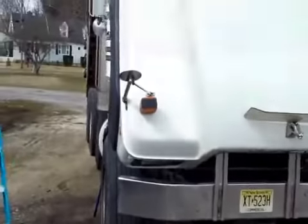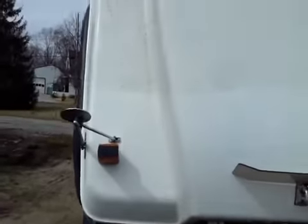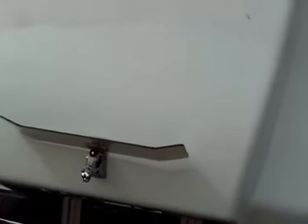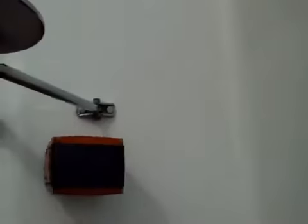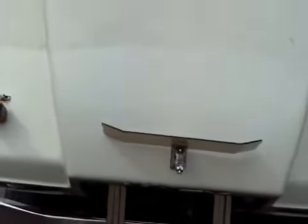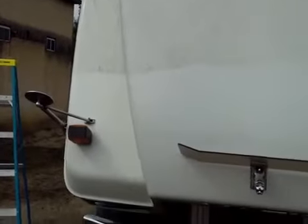After a couple of hours, we're starting to see some progress. We've got probably about one-third of this hood done. The diesel stains are coming off. If you come in a little closer, you can see the difference between the polished area — actually it's been compounded and then had a coat of cleaner wax to bring out the white and give it a little gloss. I'd say we've got about a full day's work here, just taking my time, being patient.